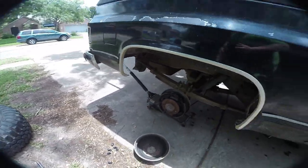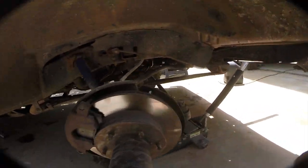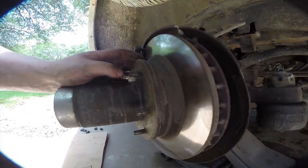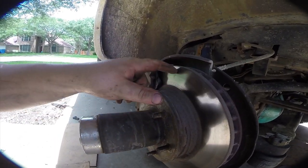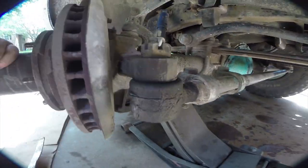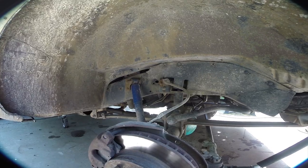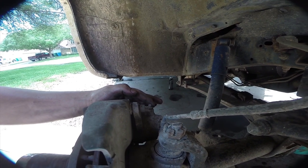Now getting around to the front — these rotors have kind of a weird casting because they're all part of the hub, so you may have to remove the hub to take the rotor off. Either way, the rotor doesn't have a whole lot of wear on it, it's pretty smooth, and the pads look pretty good. The ball joints look okay — one is a little greasy but the rest looks fine. We've got our front sway bar, not too bad. We're going to bleed these brakes the same way we did the rears.